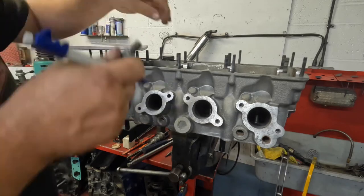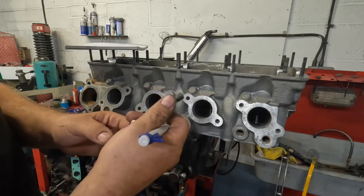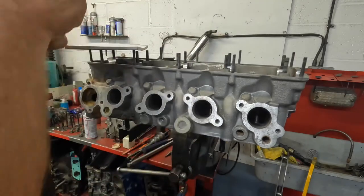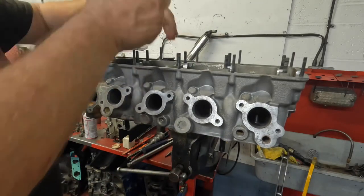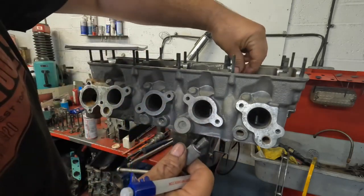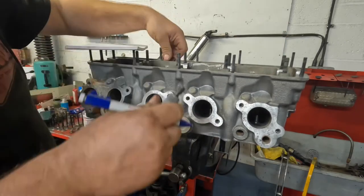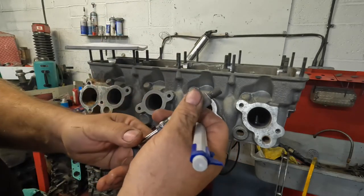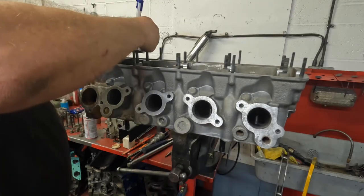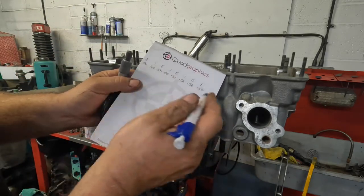And the next thing that I need to do is go back through one of the old data books and see what the tappet clearances, or the valve clearances, for this should be. Two more. There we are, that's the smallest one, I think. Yep. So straight away, I've got a range of 10 thou difference between these shims anyway.